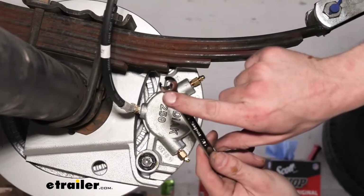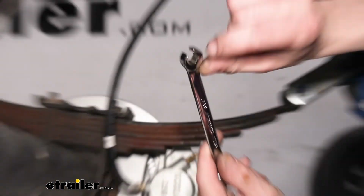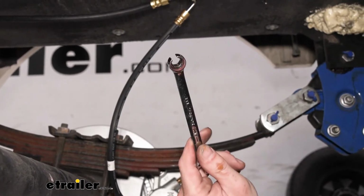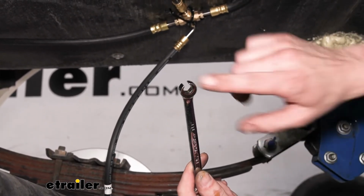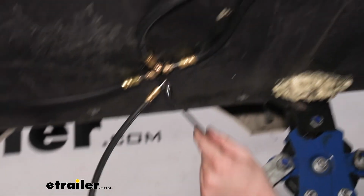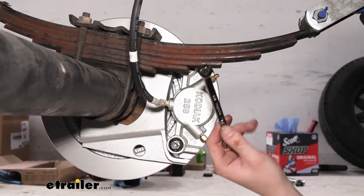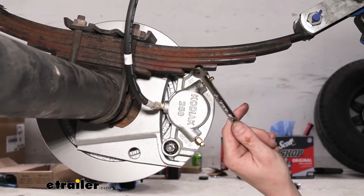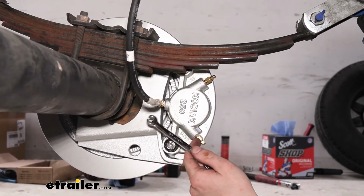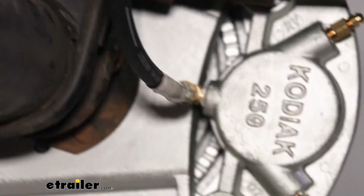It's kind of like your normal wrench, giving you those faces, but it has a small notch cut out of it, so that it'll actually grab, I would say, maybe 80% of the nut. It's almost all the way around it, just minus that little cut. That little cut lets you slide it over a hose so you can get them in place. This is important though that you have this type of wrench, because this brass that you see here is a very soft metal.